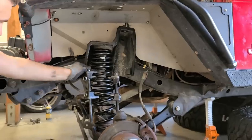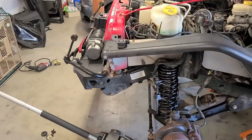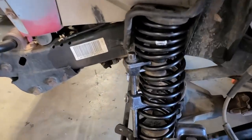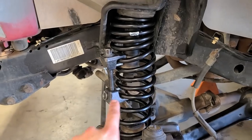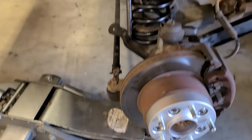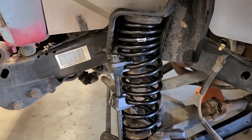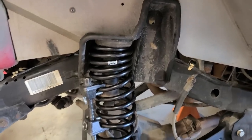I can easily remove these clamps here. Aline had to go tutor, so I'm gonna take it from here until she comes back in about an hour to 2 hours. Now I'm gonna just remove this. I'm just using a hand wrench, 3/4. I did jack it up a little bit at the end of the axle just so it holds the spring in place. Once I remove that, time to install the shock. And we're making jam, guys.